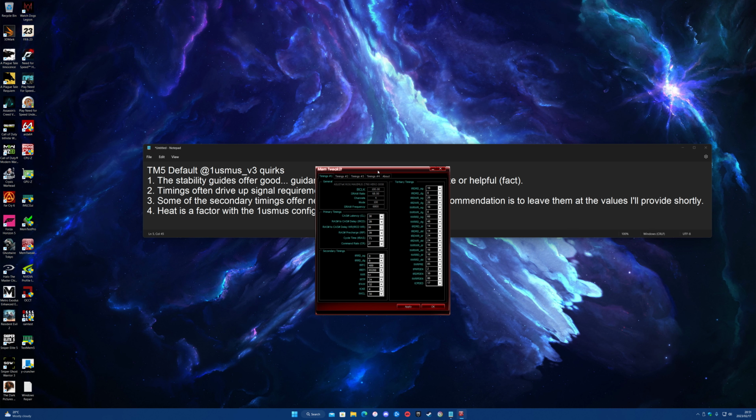From the video I linked last year from 10 gigahertz netburst, the way he explained it, tRAS being ultra low actually doesn't always mean performance, because of the operation of tRAS, if you understand it, the way the CPU uses the timing is not how you think. It's not a broad stroke of tighter is better. It's more like the RAS has to stay open for as long as it needs to do work. So having an ultra tight value doesn't always correlate to performance, because it's a bit backwards. The value of tRAS being super low just means the row access strobe has fewer cycles to work within.